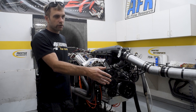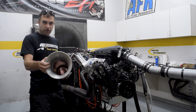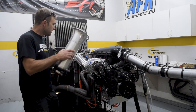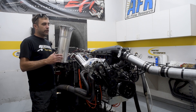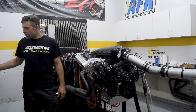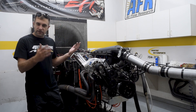We do run an air-to-water intercooler on the dyno. While we were doing this testing, I grabbed a nicer transition inlet. We were making like 19 pounds of boost roughly, stuck this on the end instead of an air filter, and picked up another pound, pound and a half of boost. Just goes to show you how important air entry is. With the filter, we were down maybe one pound, pound and a half.